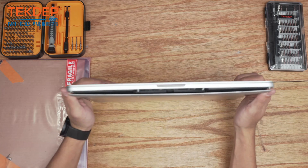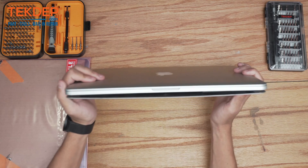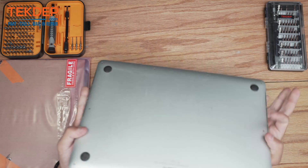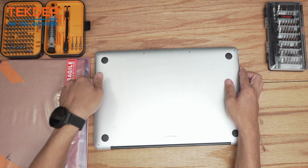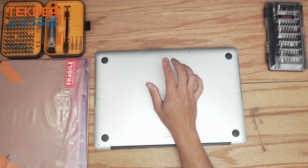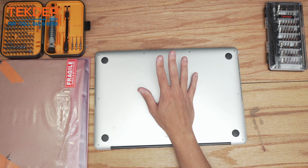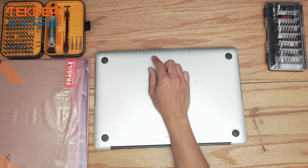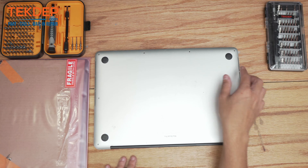The first thing you see here is the battery is bulging to the point that the bottom case will not close anymore. If there's a lot of pressure on the battery when it's swollen, it could puncture, it could just get too hot and cause a fire. So if you have a swelling battery and you notice either the trackpad or the bottom case expand like this, you want to relieve the pressure by taking those screws out.